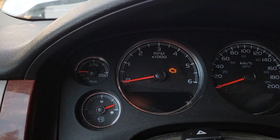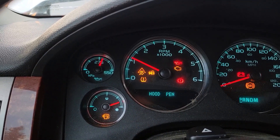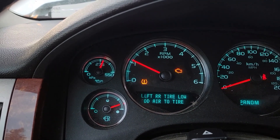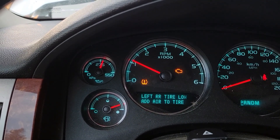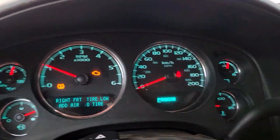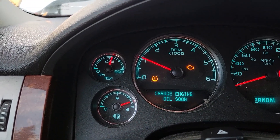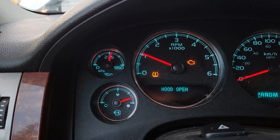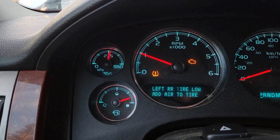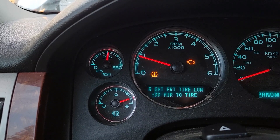So when I fire it up it makes all the oil pressure, but you'll see it'll start to drop and slowly drop to nothing once this thing gets up to temperature. Yeah, it's already started to come down. I've got some Sea Foam in it right now. I've had a few guys tell me this has happened to them and they Sea Foamed it, changed oil, and everything seems to be working again.